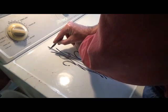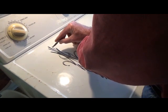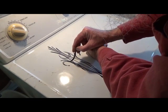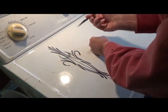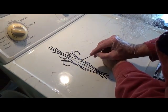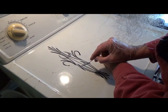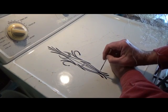One little thing I've done over the years is, when you're doing a car, the front fender, rear, one side of the car, rather than run back and forth, my memory isn't that great, and I want to get them as close as I can. So what I'll do is take a digital photograph after I've got one side done, put it in CorelDRAW, flop it over in CorelDRAW, print it out, and now I don't have to do any running around. And it usually turns out a lot closer that way. I used to do a lot of running side to side until I figured that one out.